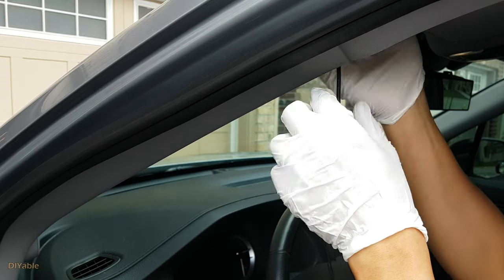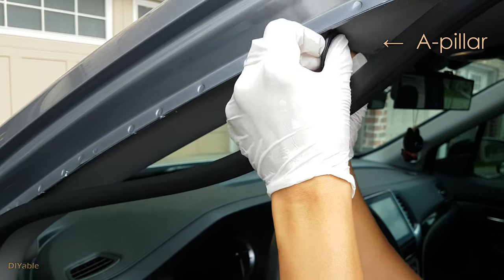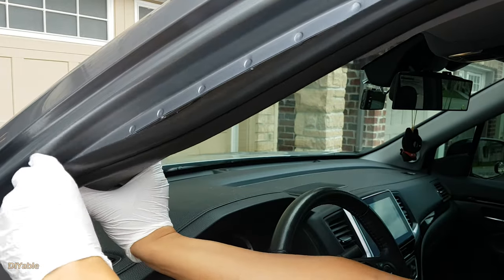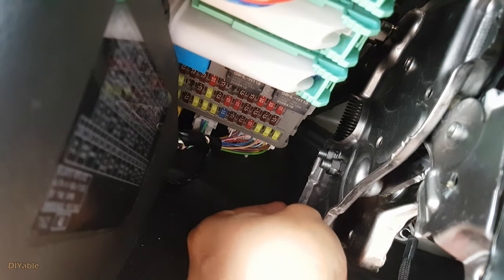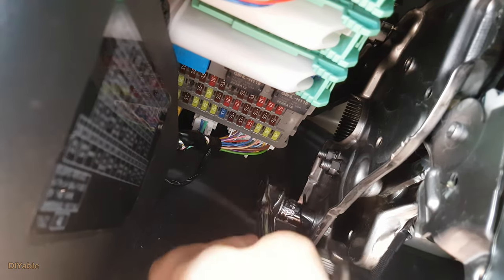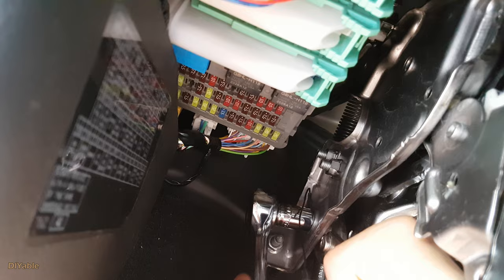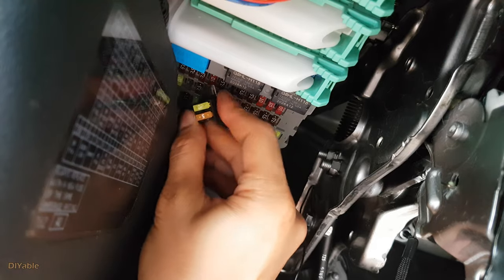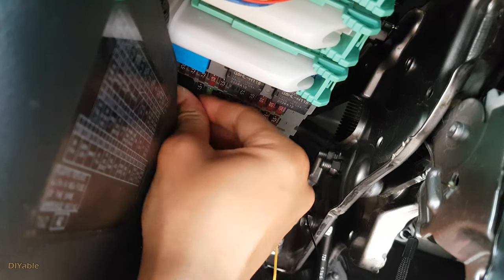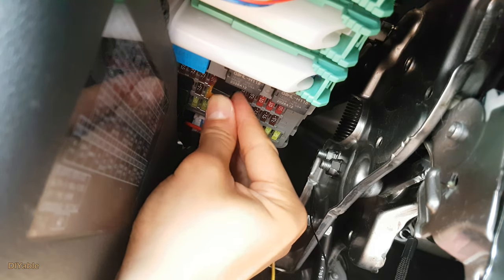To install this like a pro, run the wire along the headliner, remove the rubber stripping on the A-pillar, then hide the wire all the way down to the fuse panel under the dashboard. First, install the black ground wire by attaching it with a new screw to an existing hole on the metal and securing it with a socket wrench. Then plug the fuse taps back into the panel one at a time — the 20A fuse goes in first, and the other one goes on top.